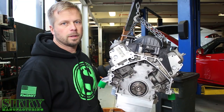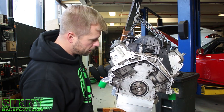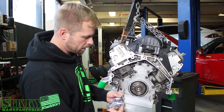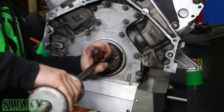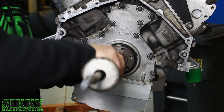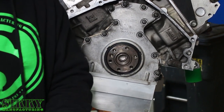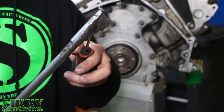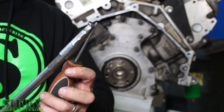Before we drop this in, we're going to put a brand new clutch and flywheel on, but first we need to take care of the pilot bearing. We're going to knock the old one out and put the brand new one that came with our Exedy clutch in there. It's basically a needle bearing, so they're pretty durable and should last quite some time. My tool of choice is this homemade hand-ground tip with a screwdriver on the back side to make it tight — works pretty good.